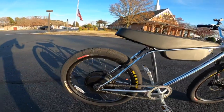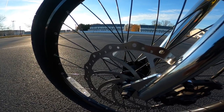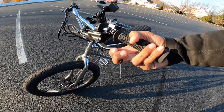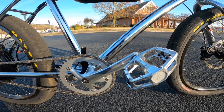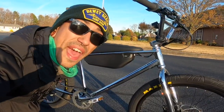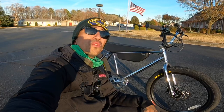The load capacity of this bike is 300 pounds. The Urban Ultralight 1100 is equipped with Maxxis Hookworm 24 by 2.5 inch tires — these tires are super nimble and very sticky on the road. We're also equipped with hydraulic disc brakes, 203 millimeters in the front and 180 millimeters in the back. Out of all my e-bikes, these brakes are the most comfortable — they grab really well and feel very high quality. This bike is also equipped with super long crank arms, so sitting down and pedaling isn't going to be super comfortable. Really, this bike is made to use the throttle. But if you do want to pedal, you can stand up — it's actually really comfortable to stand up and pedal, even with the power off. They say these bikes are meant for jumping, but I'm not 100% sure about jumping with the direct drive hub just yet.